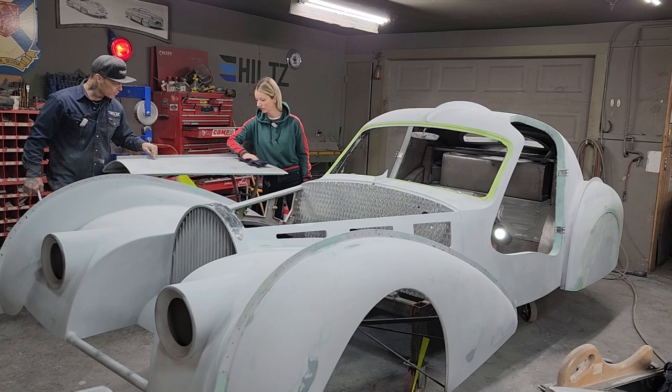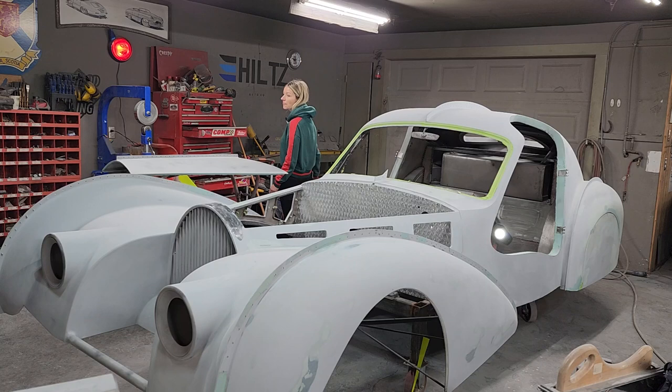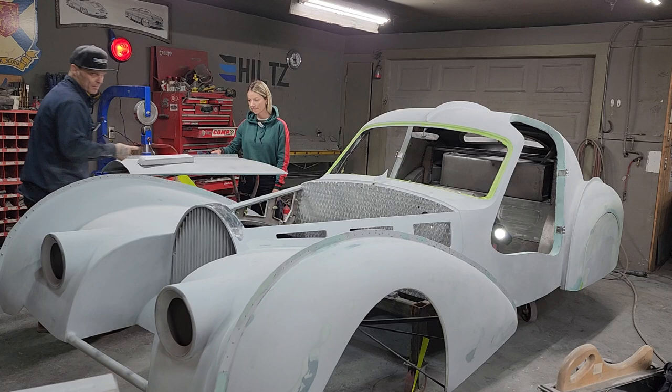And I'm going to give her a piece of 80 grit. Actually, I'm not sure what grit this is. It's in the 100s, I know that. 180 maybe. Not sure, 120 I think it is. It's on the long block. Basically, she's just going to rub along there, crisscross that a little bit. And that might be wore out, so I'm going to give her this one too. I'm going to gear her up with some 80 grit.